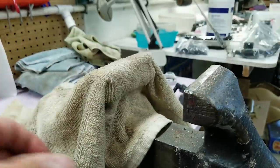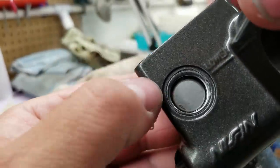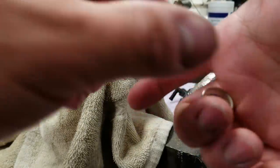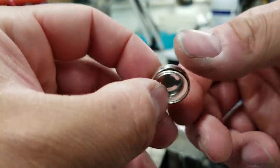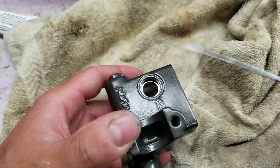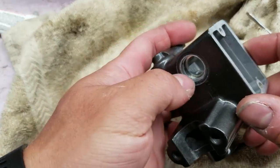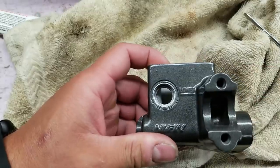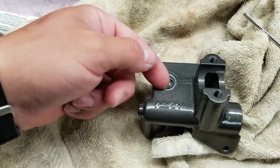When I went to mock this up, I noticed it doesn't fit. If you look inside there's a little line — that's actually a spacer. Looking at the window, there's a metal ring that I believe got left behind when I pressed out the old window. I tried prying it out with a screwdriver and a pick but it's just not coming out. So I'm going to very carefully use this Dremel to eat through one of the sides, and that should break it free — kind of like removing a bearing inner race that's stuck: you cut the race and it'll pull right out.